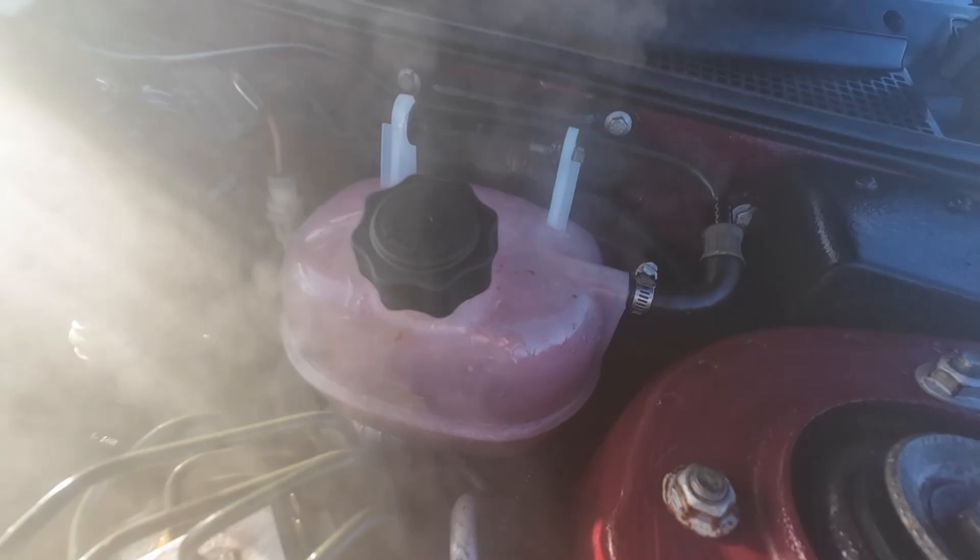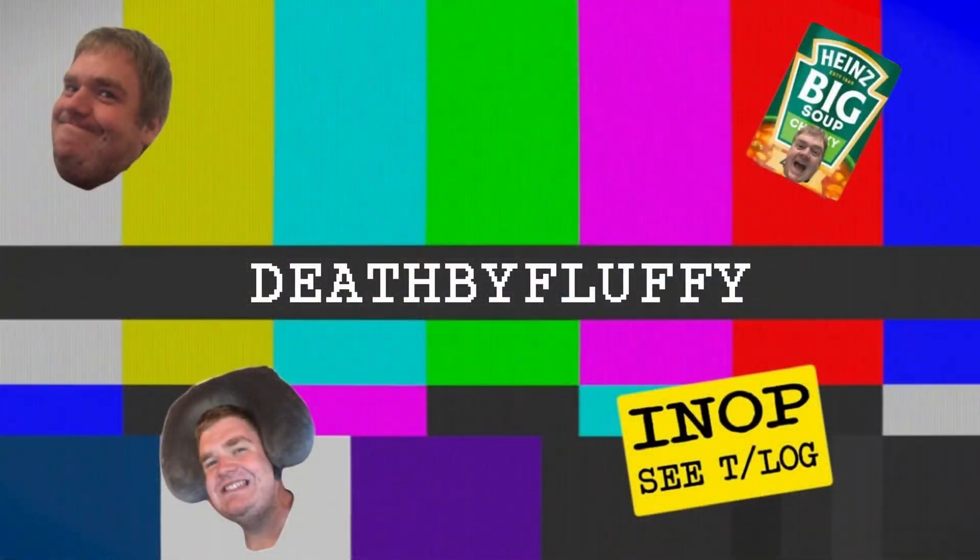Another interesting day of MG Rover ownership lies ahead. Once the car had cooled down a bit, I relied on the oldest trick in the book: carefully remove the coolant cap, refill the cooling system, bleed out any air, turn the heaters to hot, and slowly proceed to my destination — knowing full well the system wasn't holding any pressure and that I needed to keep the temperature as low as possible. This was boiling over in traffic at around 108 degrees according to my OBD2 readout.